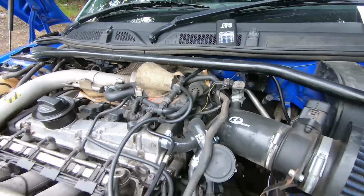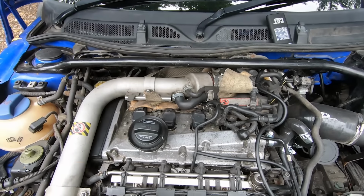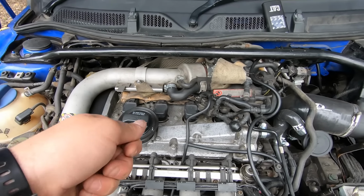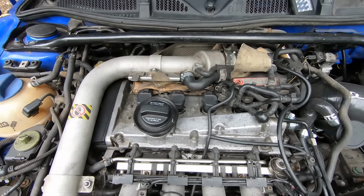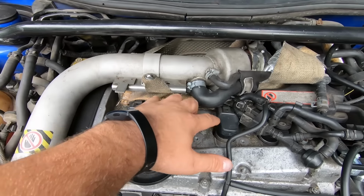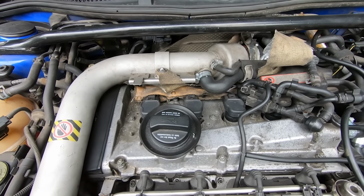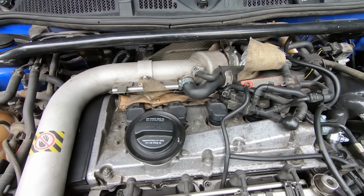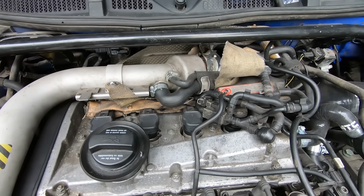All the coil packs match. Now this, if you have got an engine cover here, take the cover off. They're usually just quarter turns or twist and then you just lift off, or they could just pull off. You just want to check that all 4 coil packs look the same, because usually when they fail, the other ones aren't far behind them. So if they've got a mixed match of coil packs, it's something to certainly bear in mind, because ideally you want all 4 the same.